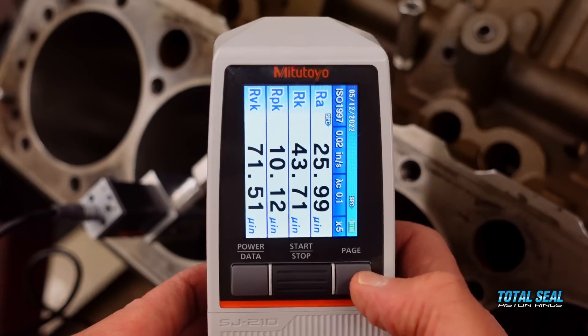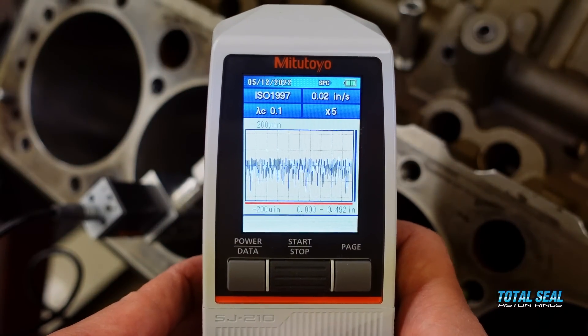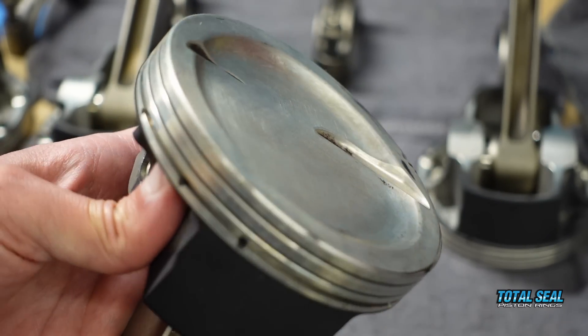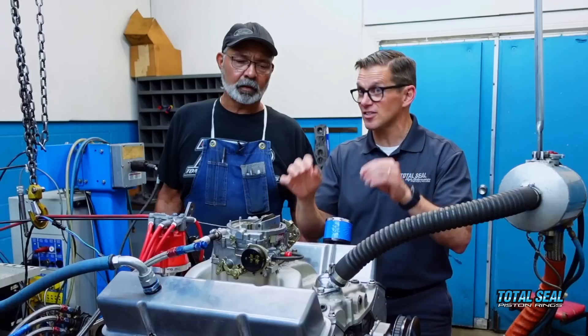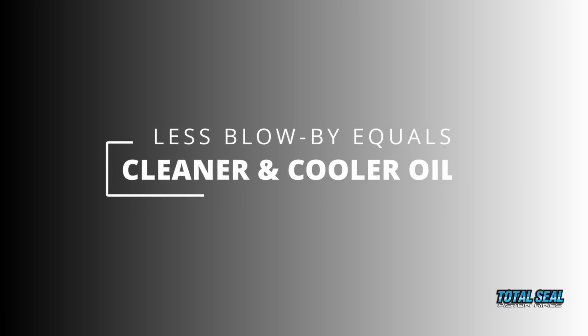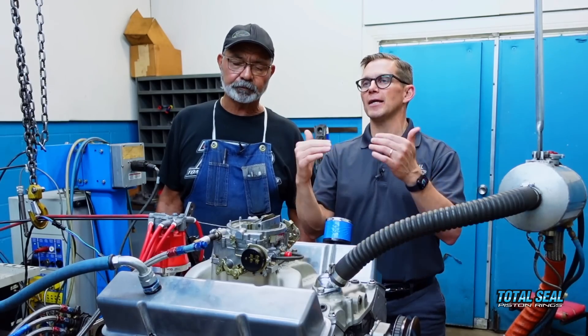The better hone with the deeper RVK and a little more peak — the engine broke in just like that, almost instantly. The guys at Line-to-Line with the better piston-to-wall clearance did a great job. This engine is more efficient today than it was last time because of those changes. Not only that, it's more efficient than it's ever been in 10 years of using this motor. The oil is clear coming out, oil temperature came down — it sealed up better. Those changes, like we suspected last time, were going to make an improvement, and we certainly saw that today.